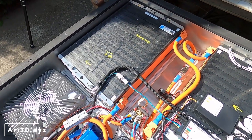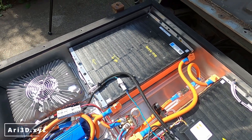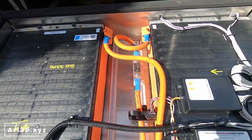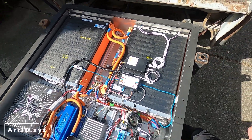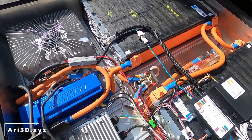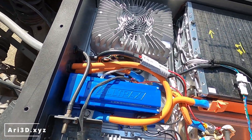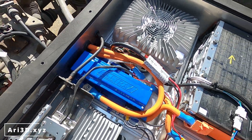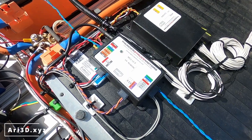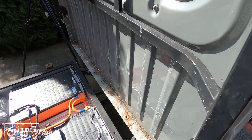And then the BMS on top and the two battery packs. These packs are out of a Ford Mustang, I believe. I opted for two of them in series which gives a nominal 72 volts, and then we've got the fuse mounted right down there. I can see all the cell taps coming off for the BMS — those go right into the factory connectors in those batteries. The motor controller connects over USB for some telemetry, and the BMS from Thunderstruck as well over CAN through that CAN bus adapter up to a computer in the front.